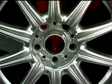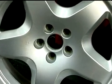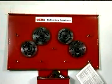With the variety of wheel center designs in the marketplace today, it is a challenge to accurately mount wheels on the balancer. Is the wheel hub-centric or lug-centric? Should you back-cone, front-cone, or use a bolt-pattern adapter? The Coats Pin Plate Balancing System provides a consistent method to accurately mount and balance most wheels.